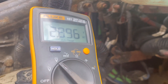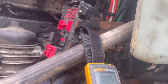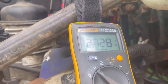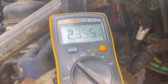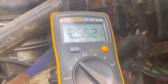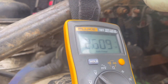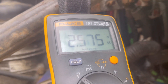I actually got about 5 volts more than what we had just by wiggling the harness at this main distribution box. You can see voltage increase and voltage decrease. Although I already had this whole fuse box and distribution box apart, it looks like I have to check voltage at all these fuses again.